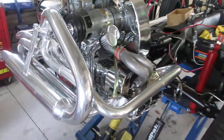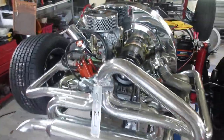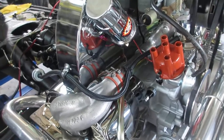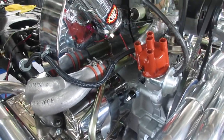I went to prime the engine. I got the spark plugs out, and I do this: I want to spin it over and get oil flowing. I went to prime the engine, and the oil pressure switch didn't work, as I just mentioned earlier. Anyway, I cranked and cranked and cranked, and I got oil pressure.